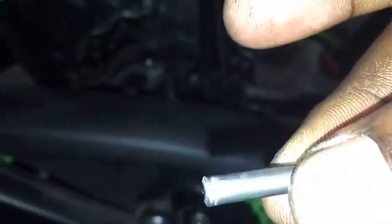Sometimes people ask, how much should you rivet those? Well, let's take a look at the pin that we pushed out. Let me get it on camera so you can see it here. If you can see that, there really isn't much of a bevel on that at all, really. It's just enough to keep it captive without causing increased resistance as that's rotating around.